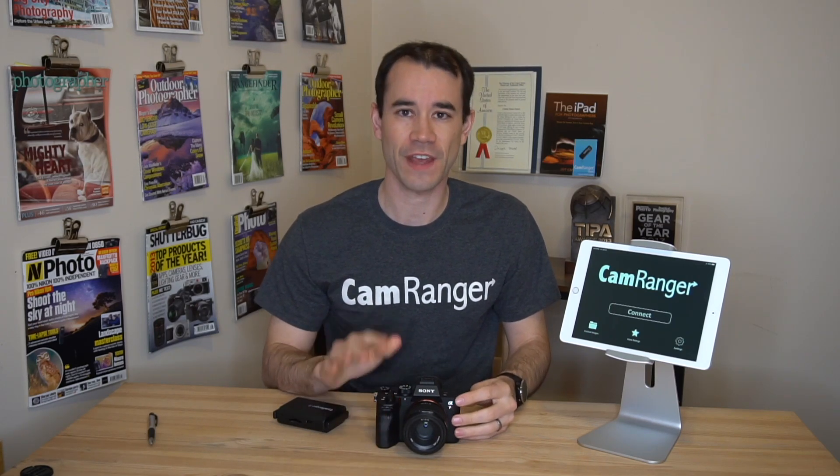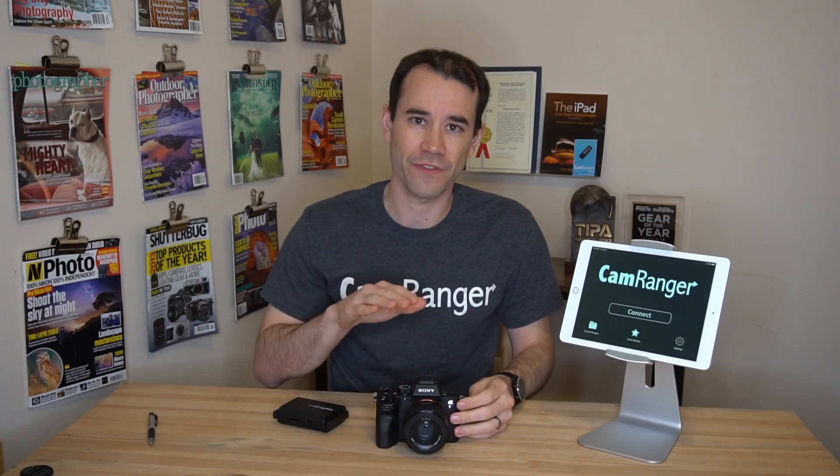The first thing you need to keep in mind is fast memory cards. You want a fast memory card within your camera so it can save images to the card quickly. We also need to have an SD card within the CamRanger. We need the card because we can't actually access the images on the camera's memory card — instead we quickly save them to the CamRanger's memory card where they can be wirelessly transferred. Anything 50MB write speed or above is good.